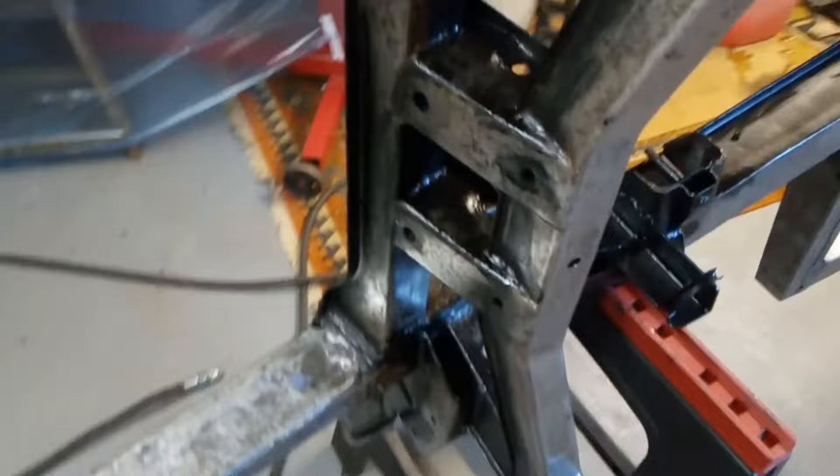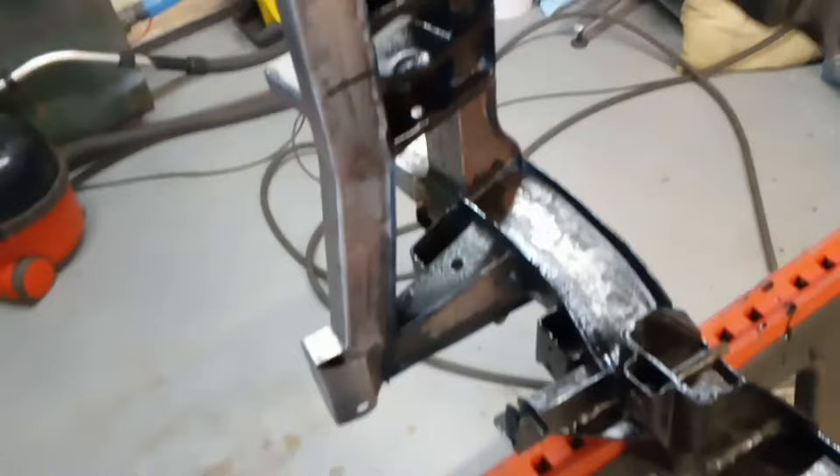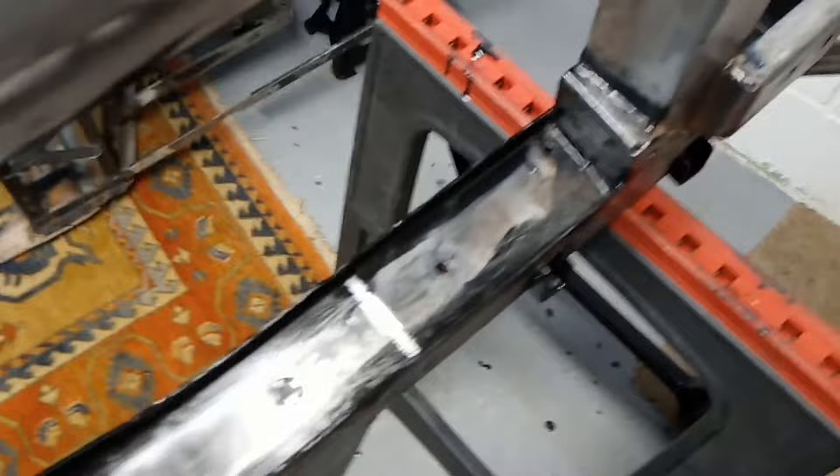Yesterday I did some stripe coating, which is basically using a brush to get into all the little nooks and crannies where it's difficult to get into, so it doesn't look great at the moment. I've got into all the little nooks and crannies where the spray gun might produce a bit of a vortex and not cover properly. I've also gone over all of the edges with the epoxy mastic so it's covered all the edges — obviously when I spray it'll cover the edges again.